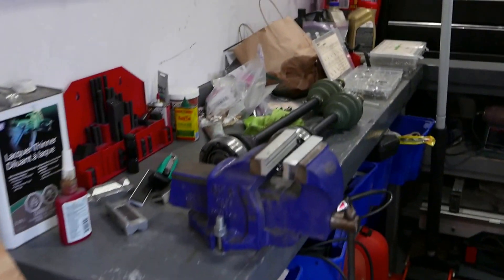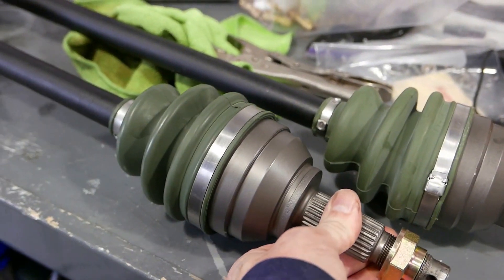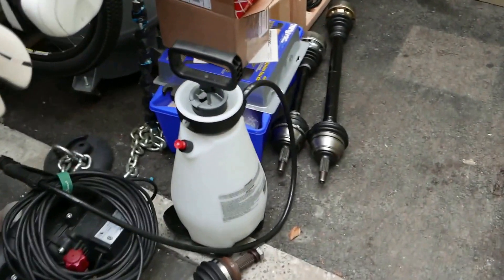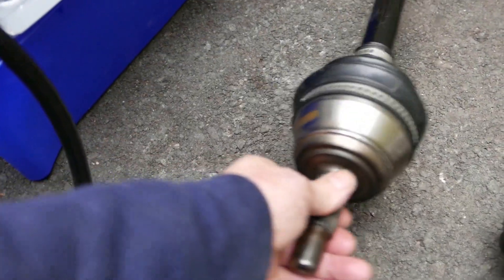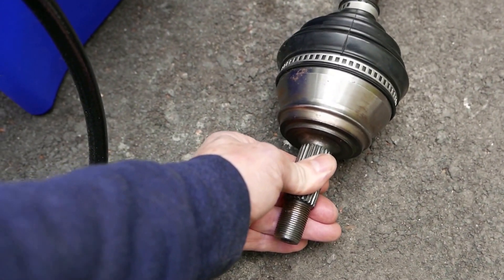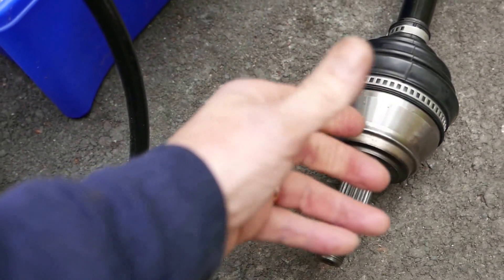There are the new axles over there and they're nice — nice and firm. There's no wiggle, no movement at all, no looseness in this CV joint. I took the other ones off and I'm going to chuck them. These guys are brutal, they're junk. It's all wobbly and loose — vertical play, a clunk in it, as well as twisting the shaft. Not sure what happened there.